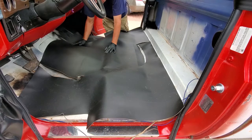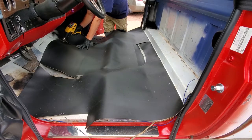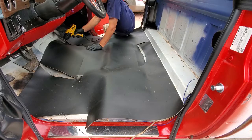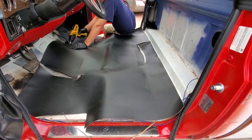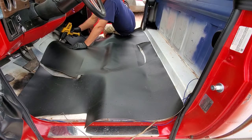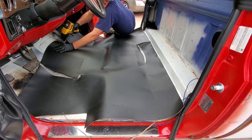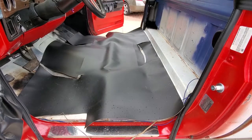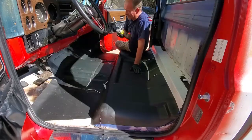If you see I'm coming in with a heat gun — be sure you at least wear nitrile gloves. You might want to wear leather gloves because you really want to heat up this material fairly hot so you can push it into place and make it conform. This is going to take you some time, but it's going to save you so much money over going and having a professional do it. One caution with a heat gun — this has really happened to me — always unplug your heat guns when you're done using them. I've had one catch fire just sitting there, probably because something got too hot inside. Luckily I was in the room and could walk it outdoors. There you see what happens after probably 45 minutes worth of work — everything conforms beautifully.